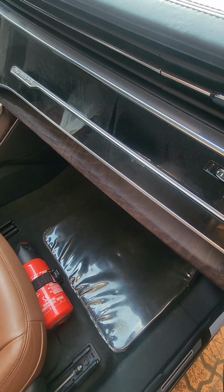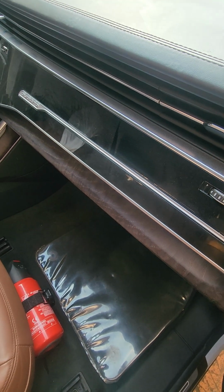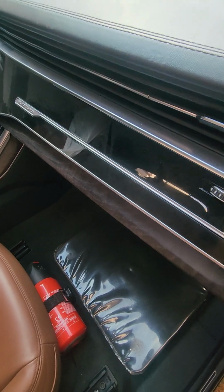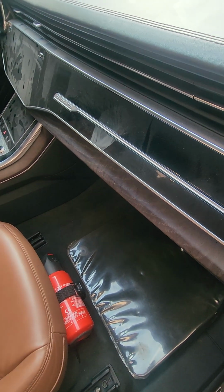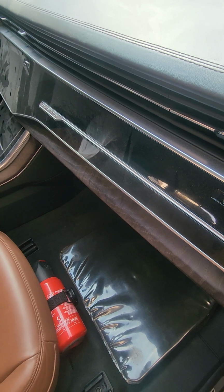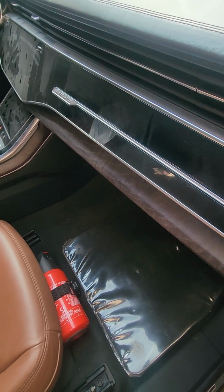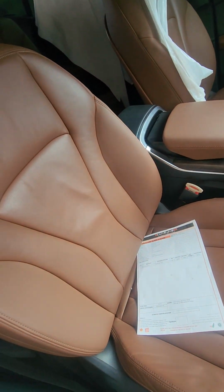So I tried to check all the cell voltages and their capacity one by one. I see one is 13.5, another one 13.5, another one 14.5. So all the current is not stable. One is 2.9. So the voltage is not stable. That's why I decided to replace the hybrid battery.